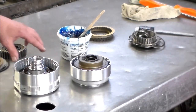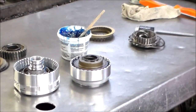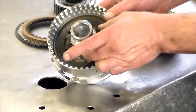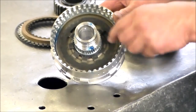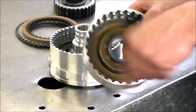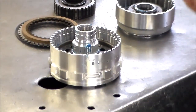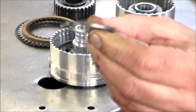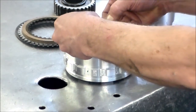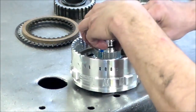This can be a little bit of a thick snap ring — it'll come right out but sometimes a little bit of a pain to get in. So you've got the basics of putting the input drum together. The snap ring is in — no problem. When I pressed this down, this doesn't sit exactly centered, so I had a screwdriver and moved it around, then it dropped in and the snap ring went right in. For the low drum, we're going to put the non-rotational rings on. You see the little tab right there — so let's do that first.